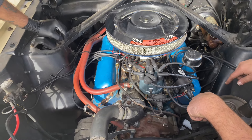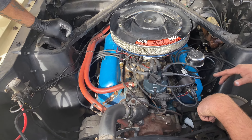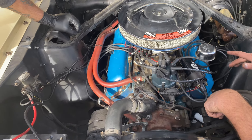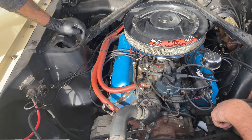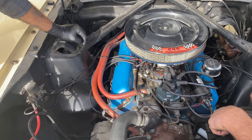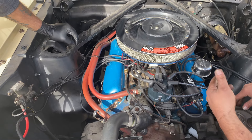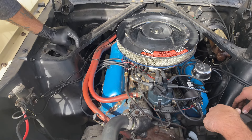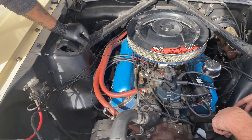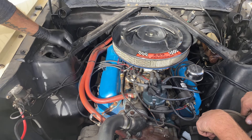This block is pretty clean inside - it's been steel-abrated before he got it rebuilt. If you really go to the machine shop and they run it through the steel-abrated tumbler for like two days, it gets in there and cleans much of the crud out. And then if you run proper coolant mix, it never happens again. So what is a proper coolant mix? 50-50.